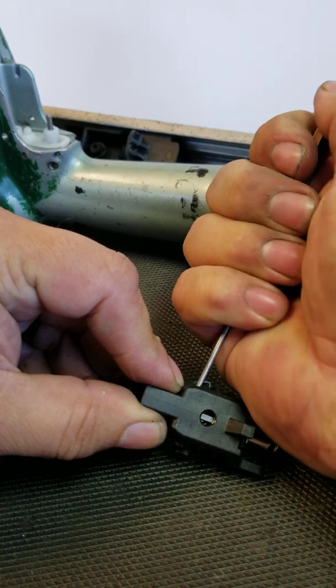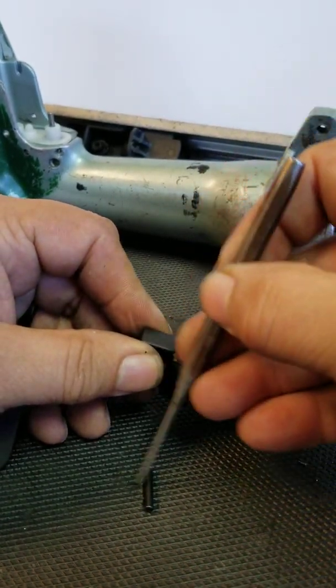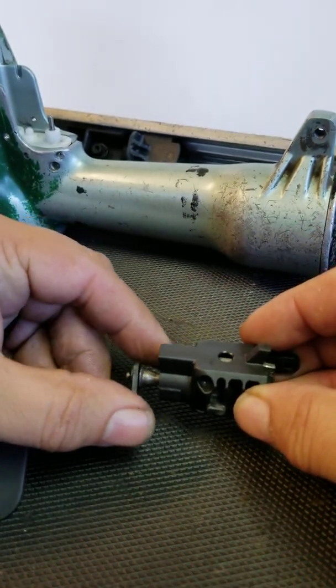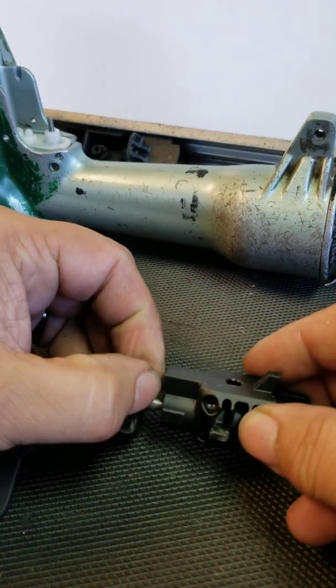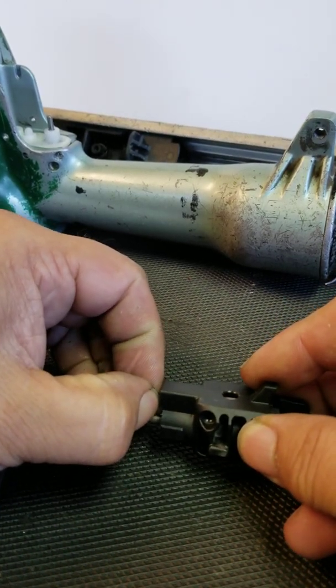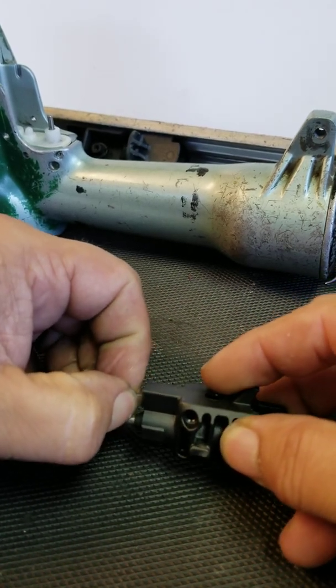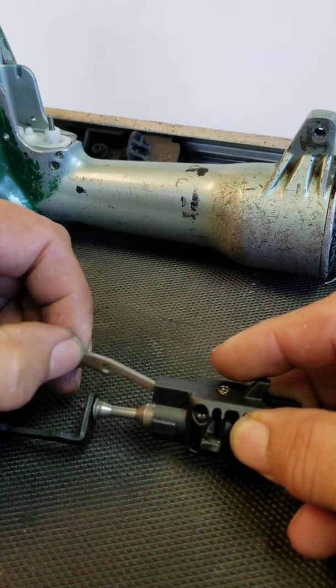The first thing we're going to do is take out this pin — knock this pin out here. You may have to tap it out with a hammer, just don't lose it. Take that out. We're going to pull this plunger out a little bit to where I can actually push this arm back — push that arm back so I can grab a hold of it. Put my finger over that hole a little bit because that spring pops out.